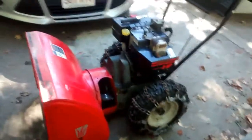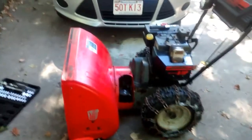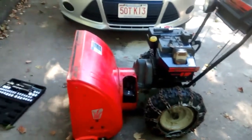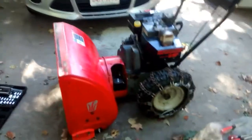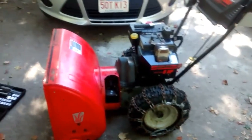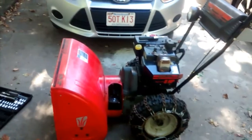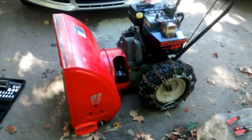There's one little trick I learned from him. There's a little screw in the carburetor — it's not really a jet, but this is one of the newer carburetors, so it just has a dump valve on the bottom. It doesn't have any adjusting for the jet. There's no adjustment. It was surging a little bit — take out this one screw, and there's a little air jet in there. You just unclog it, put it back in, and it's just running fine. The guy's just amazing.